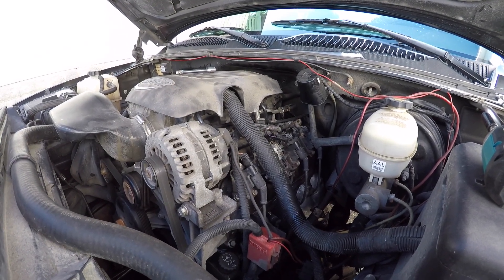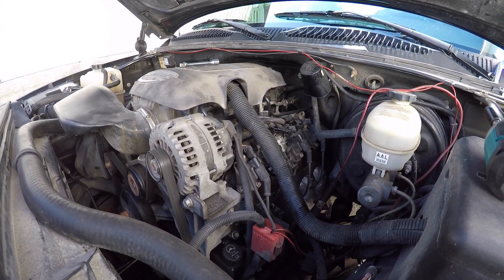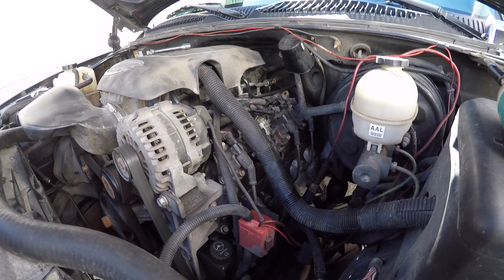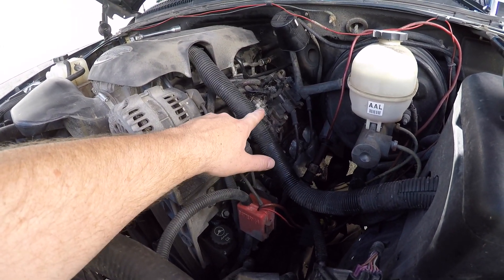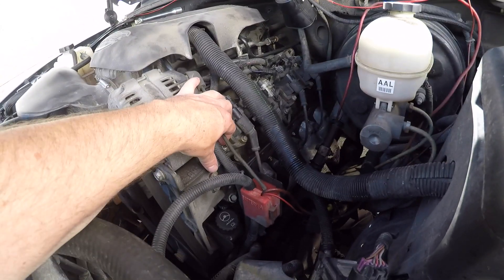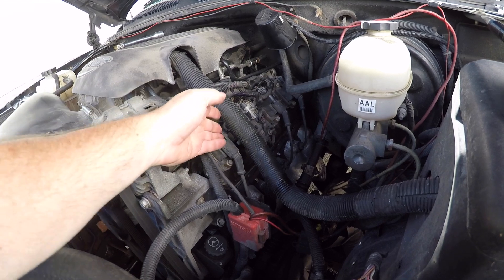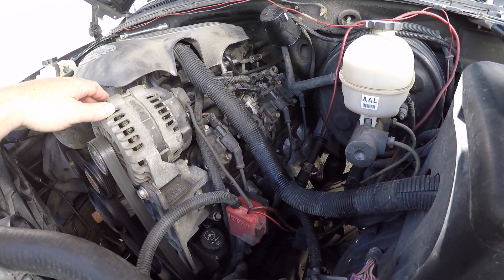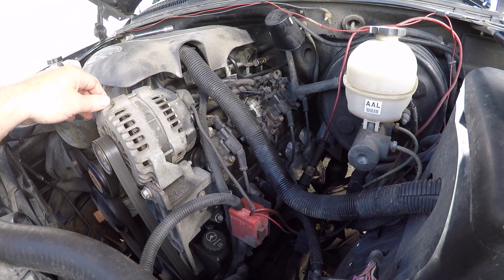To confirm what I suspected was a cracked head, what I did was just pulled the valve covers off and had a look under there. To pull the valve covers off, it's pretty simple. It looks pretty involved, but it's really not. You just need to take off the coil packs. They're all packed together on a bracket and it's just some 10mm bolts or nuts on there. You just take that off, then pop the valve cover off and you can have a look under the valve cover to see if there's a bunch of sludge under there. I'll show you what that looks like in a minute.